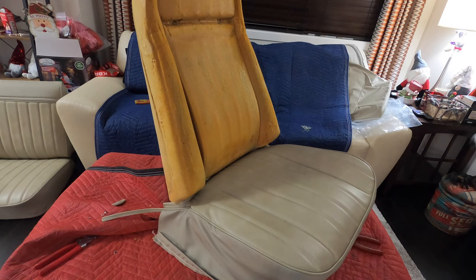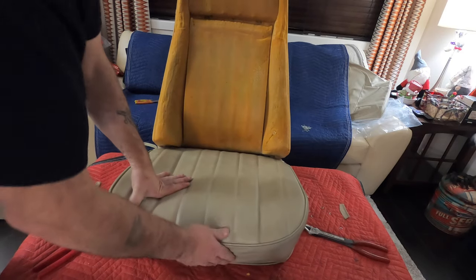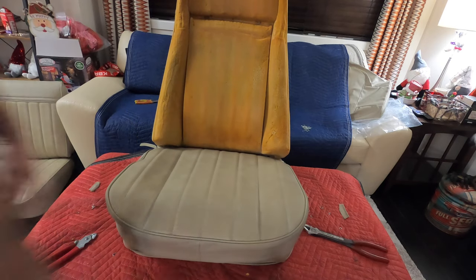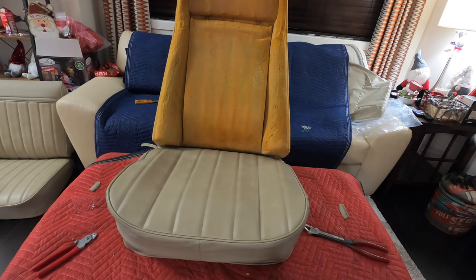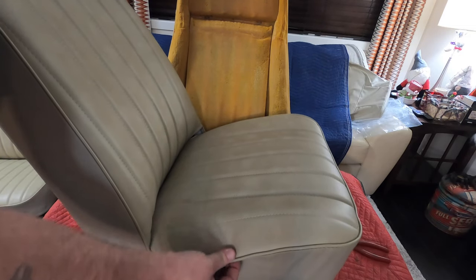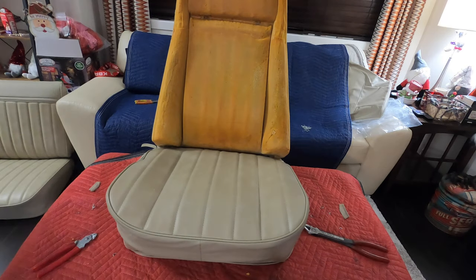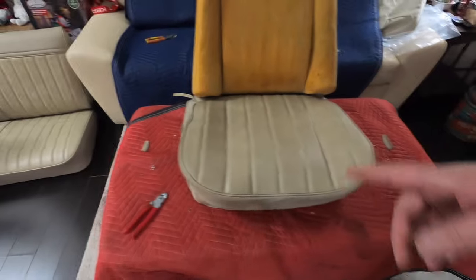I am less concerned about a wrinkle here than I am about the overall fitment. I want that to look good. I'm not so concerned about a wrinkle up against the door jamb or up against the console wherever this seat ends up. This is the other one — the exact same spot — and I end up with this here. I'm pretty sure that's going to come out over time, but we got rid of the majority of everything. So I'm not gonna sweat too much on it. Let me get this area cleaned up — I've got broken hog rings and whatnot over here. I'll get my area cleaned up and then we'll come back and flip this guy over.